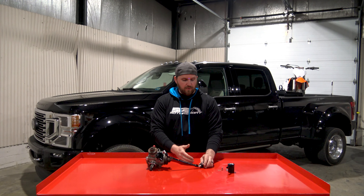The way we get around that and the way the disaster prevention kit works is instead of feeding these heads from the case of the pump, we end up feeding the heads from an auxiliary fuel line. The way we achieve that is with this block that goes in for the metering valve, which essentially lifts the metering valve up out of the pump and we're able to auxiliary feed the metering valve with clean, fresh fuel and block off the feeds from the crankcase.